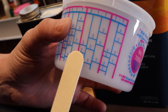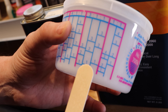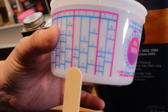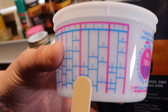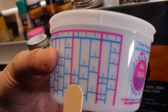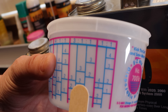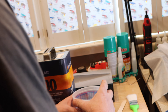Last time I used it, it was way too much, so I'm going to go down to here. That's how you measure it — if you fill it to here, that's 3 to 1. So you fill the resin up to the two line, then fill the hardener after. So now we're going to get this mixed up and then start laying the fiberglass and carbon fiber.